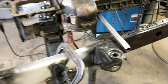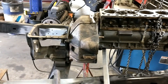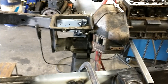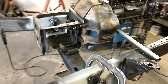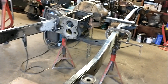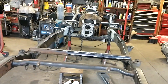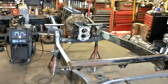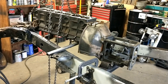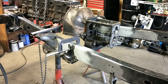So it doesn't rust in the future. We've got the 3FE block, the late FJ60 bell housing, and an H42 transmission case — that's what I use to mock this stuff up, unless I'm doing it in a car without taking the body off the frame, in which case I'll just use the original block that's in there. No point in taking it out, but basically same thing — use that case, use a bell housing, get it all set in there right. Works pretty good for me, it's the easiest way I've found to do it.